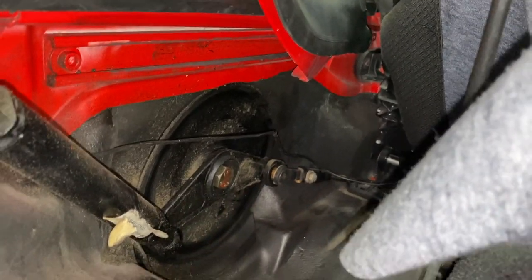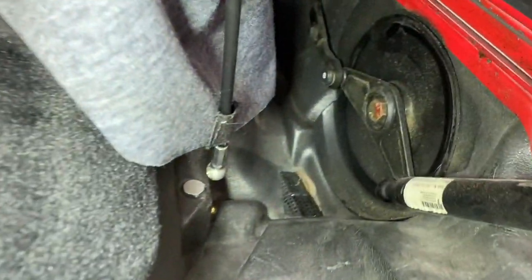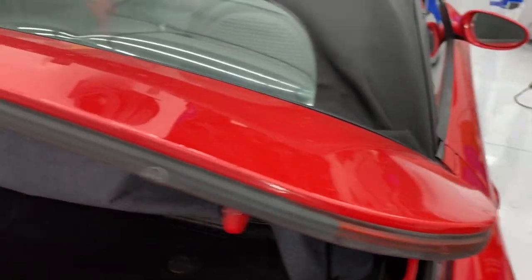This part here is what they call the transmission on the left side. I've seen pictures of it but it's really hard to tell where that stuff is from a picture, but from the video you can see it's against the outside wall here. Coming over to the right side of the car, you can see how that rod with the little red plastic end is connected in the right place and is working. So when my top opens and closes it is turning both transmissions at the same time, but only the one on the right hand side is actually working to push the top forward and backwards — that's why my top feels a little loose when it gets to the closed position. This transmission on the back end is connected to the clamshell, and that's what raises and lowers the clamshell, so my clamshell isn't having a problem because both of those are working.